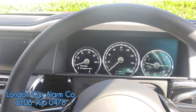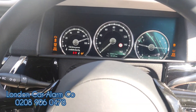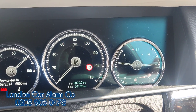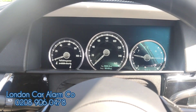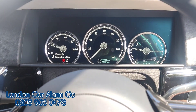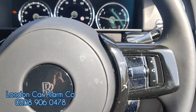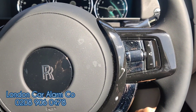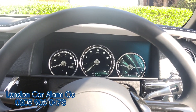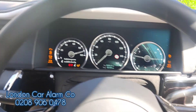If I leave it 10 seconds now, I'll be able to start it and select a gear — it's gone into drive. It's now in valet mode. When the customer gets the vehicle back from the car wash or his service, all he does is tap, tap, tap to get the ignition on with his foot on the brake, then put the code in — two bleeps — out of valet mode. Within 10 seconds if I start it and select a gear, the vehicle will stall — we know the system is active and protecting the vehicle. No melody, selected gear, there you go, system disarms.